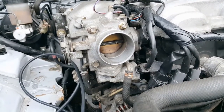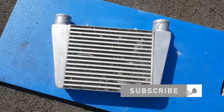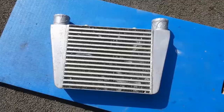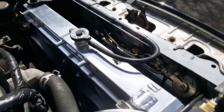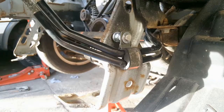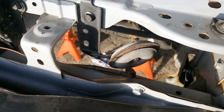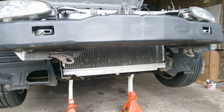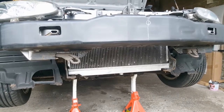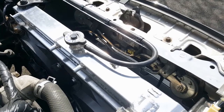Well, you've probably guessed it by now from the video title - install an intercooler. This intercooler you've already seen in episode 17 of this series, where in some ways I already took care of the most difficult part of this install, because I relocated a bunch of stuff in the front of the MX-5 so this thing would physically fit. I moved the radiator, the power steering pipe, the horns, and a few other things. So all I need to do in this episode, in theory, is make a couple of brackets to mount it in front of the radiator, which is the ideal place for one of these air-to-air intercoolers to go, which I'll explain why later. For now, let's get this thing installed.